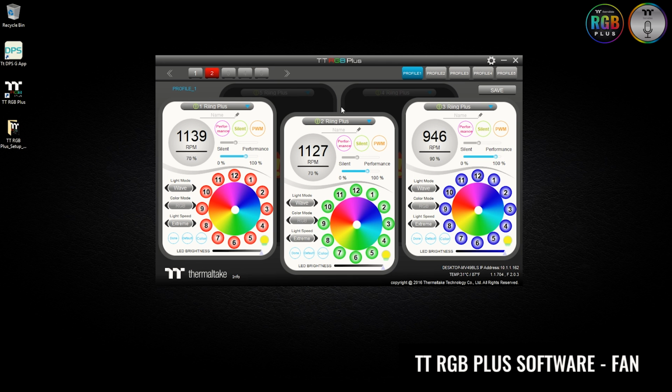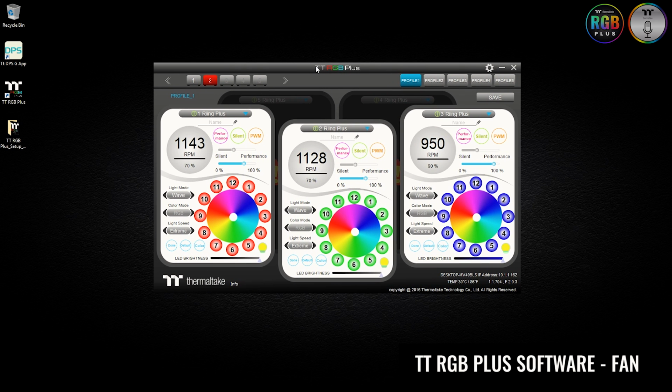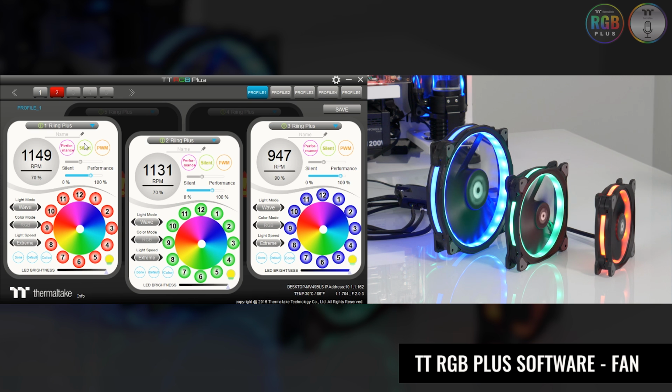Now I've already downloaded and installed the software. This is our TT RGB PLUS software, and I'm currently using version 1.1.7. This software, once installed, allows me to configure a variety of products, and we'll be talking specifically about the Ring Plus fans. Now as you saw earlier, I connected my 3 fans to ports 1, 2, and 3 as shown here in the modules.